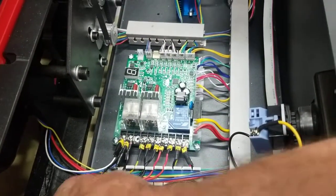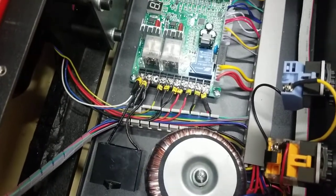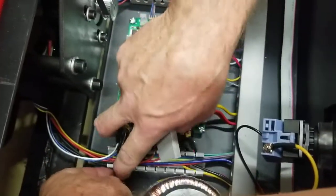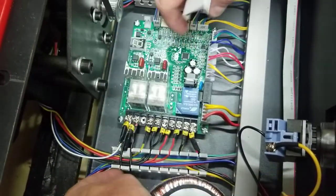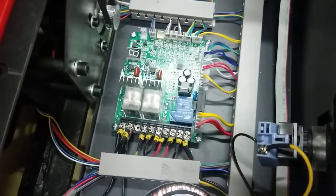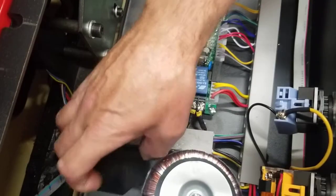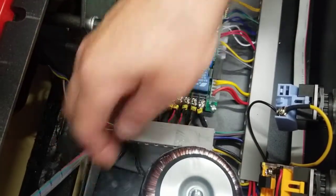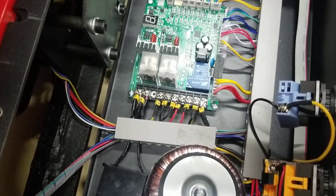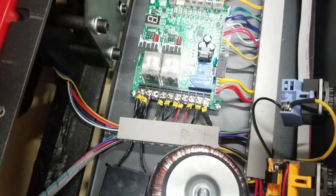The wires are sometimes short, so you can lay the capacitor flat on its face if needed, then feed the wires back into the channel — you can route them out the back of the channel. The cover just pushes down and clips into place. Typically they'll send you a 31 µF replacement; 27 µF can be enough, but don't go much higher or you could burn out the clamp motor. 30 µF is about right.